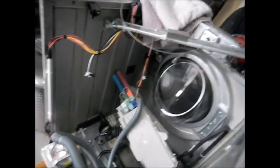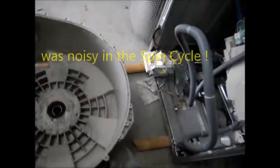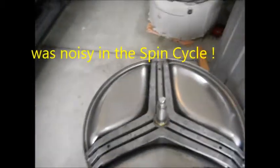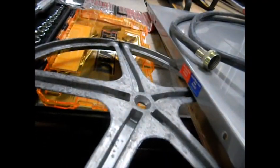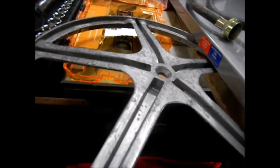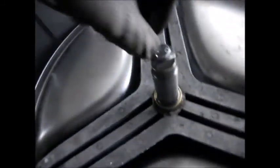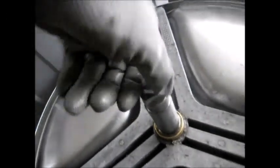Basically, you have to disassemble the whole thing. When the barrel's sloppy, the basket's sloppy. And this one — we couldn't get this pulley off. It would not come off. It had an Allen head and it would not come off. It was tight, and I heated it up several times. We had to drill it out, and then I've got another bolt — a regular bolt — for it. And of course, we're going to put the anti-seize on it.